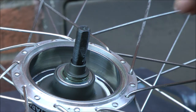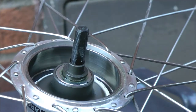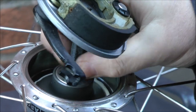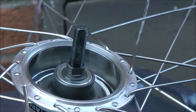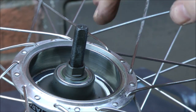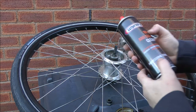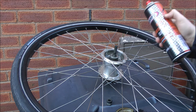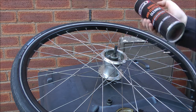Give those a clean up with some sandpaper and inside as well. I'm going to have to bust that glaze. I'm going to have to lightly sand inside the drum as well, give it a little bit of a scoring just to help it bed in, and then clean it with some brake cleaner. Brake and clutch cleaner — there's various brands available, some bottled, some aerosol — brilliant for cleaning random bits. You can also use carburetor cleaner, methylated spirits, or if you want to waste fine alcohol, you can use vodka or gin.